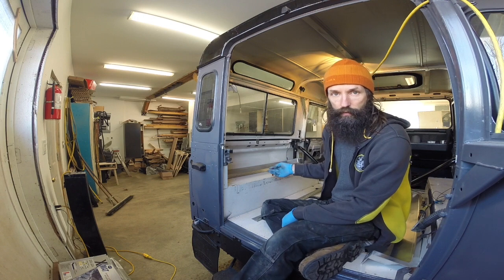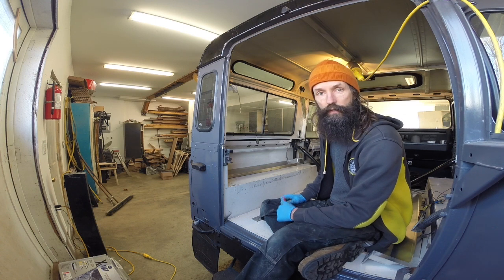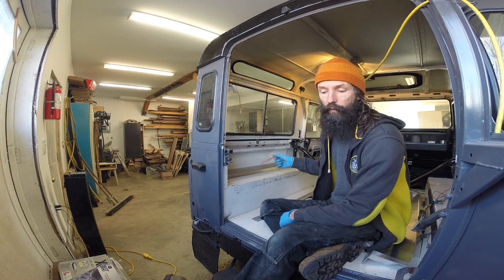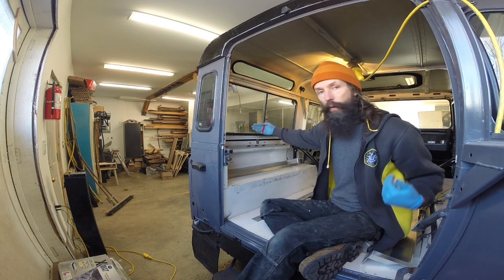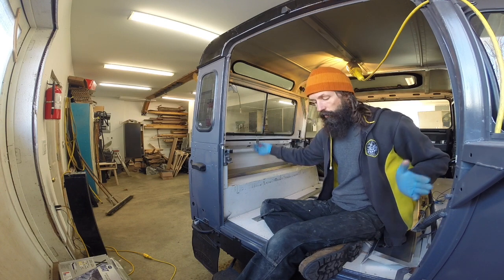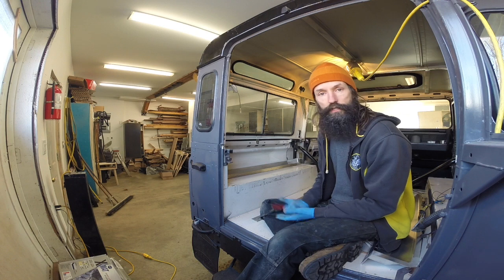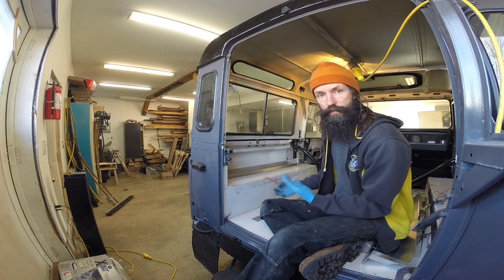The reason I'm going to the new seats is because they're forward-facing seats. They're the more modern, more safe ones, and I've got a young son who loves to sit back here in the jump seats, but they're not really that safe, so I want to put in forward-facing proper shoulder belts. You can get them from Exmoor, where they've got the flip-away seats, which is a little less work. However, I like the OEM Land Rover ones because when they're folded down, there's more space in between them. They also therefore match my OEM front seats. I bought them as a set, and that's just the route I've decided to go. So you could do it the easier way without the modification, but there is some trade-off.